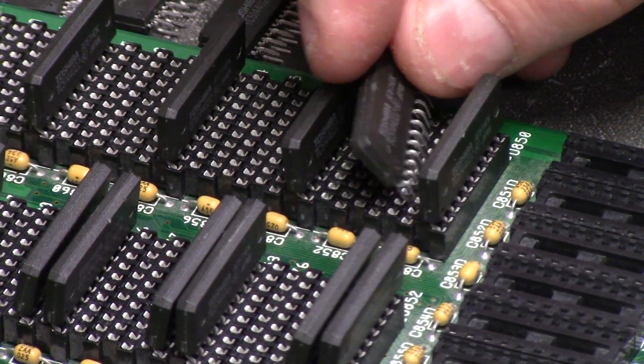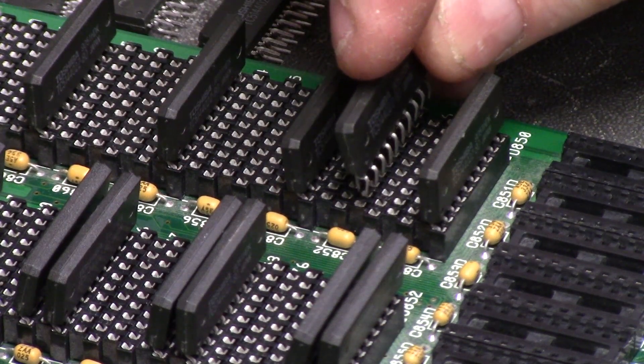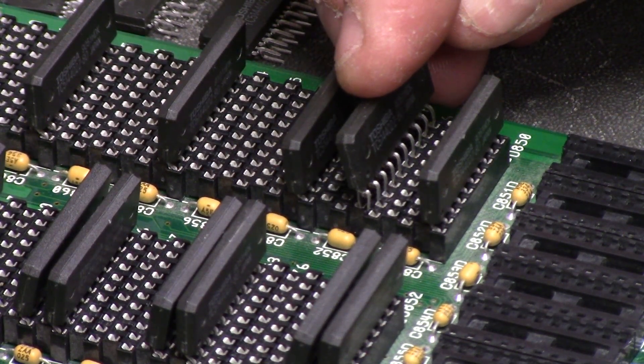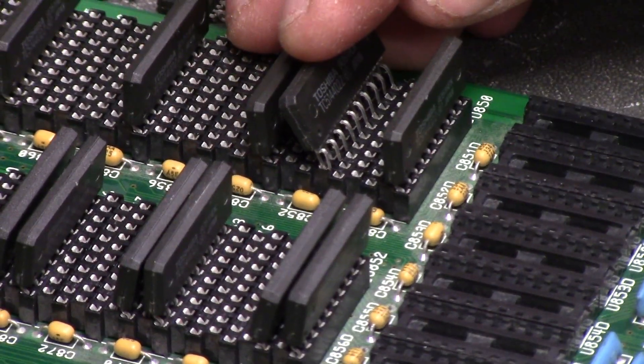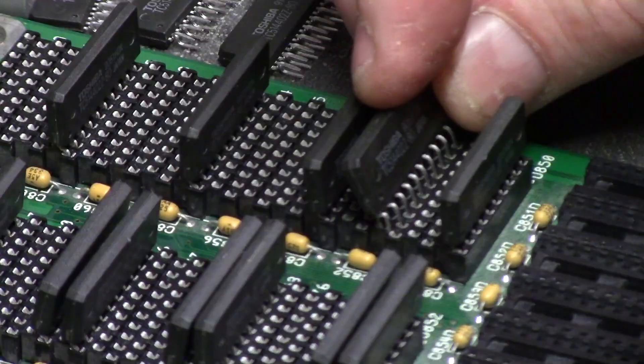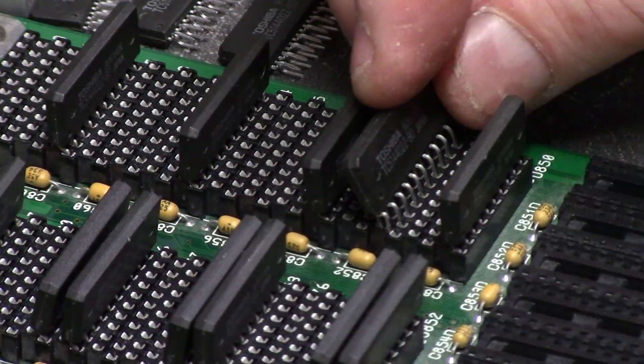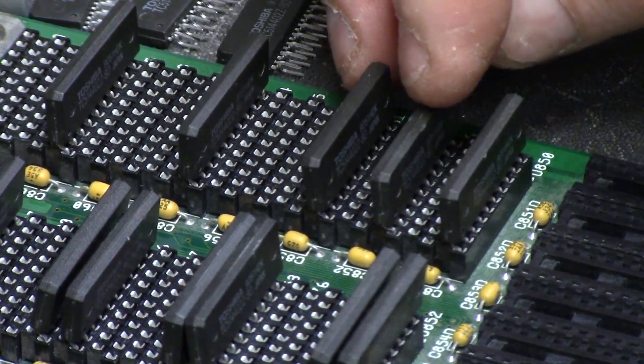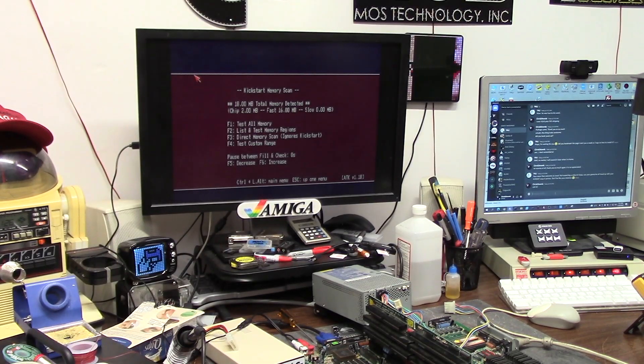I'll do this backer socket. I stick the back legs in and then I kind of smash my hand against the riser card — they're all folded over. If they're not, I use a little poker tool and make sure I got my leg — come on, get over the line. There we go. You don't want to hammer down. I always give it the wiggle-wiggle — see? I skipped a socket just for example, just to do a test.